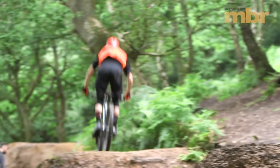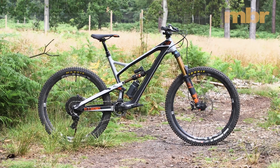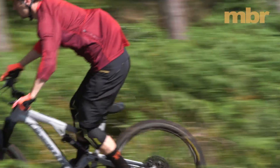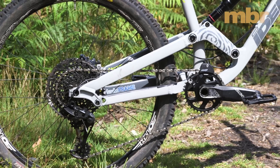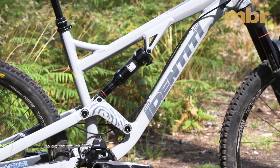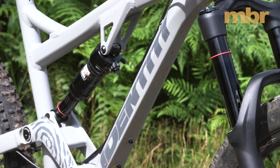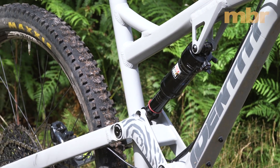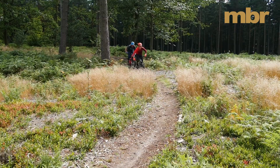Given that the Jeffsy is a full 2kg lighter than either the DMR or the Identity, there's certainly room to manoeuvre. We like the fact that Identity doesn't use a bullshit name or daft acronym for its suspension design. Instead, it just speaks plain English, describing it as a 4-bar design with 160mm travel. All of the pivots use the same bearing size, which makes life much simpler, and it's been designed around the new metric shock standard.